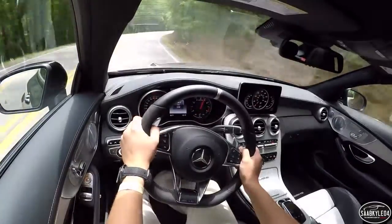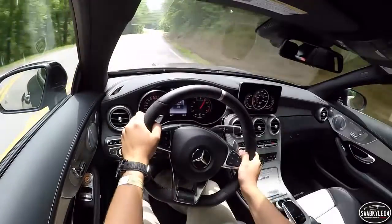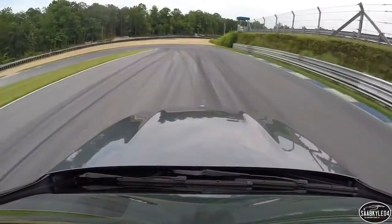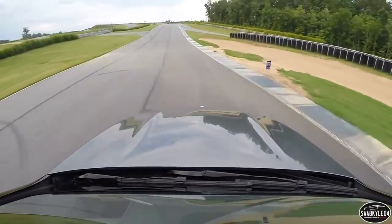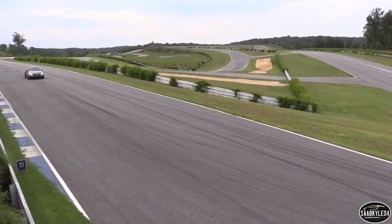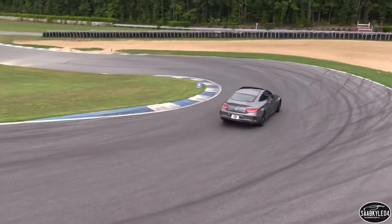One big benefit is faster engine response as the gases have a much shorter distance to travel before hitting the turbos, practically eliminating turbo lag. The linearity of acceleration and how quickly the C63 accelerates, both the sedan and the coupe, is so impressive. That flat torque curve doesn't hurt either. When you hit the throttle, the engine roars to life and immediately launches forward with authority.